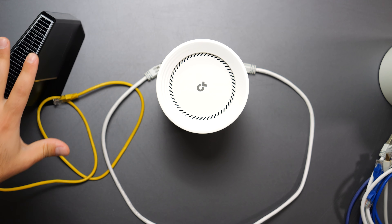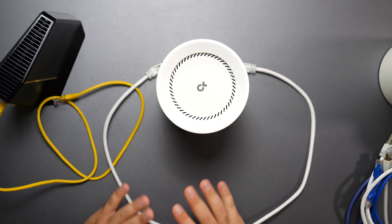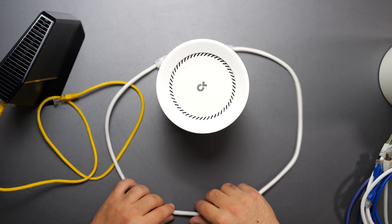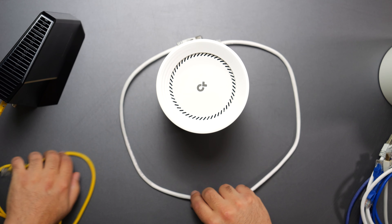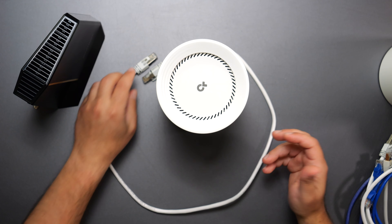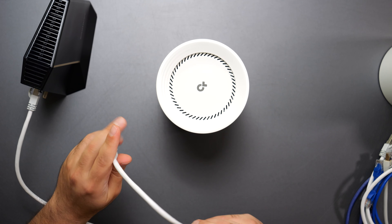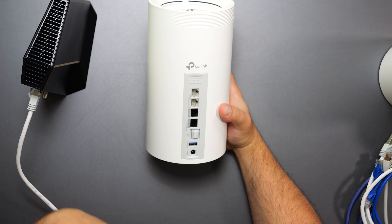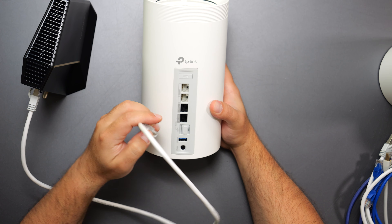This modem is capped up to 2.5 gigabits, but setting that aside—if you're going faster than gigabit, even though CAT5e is okay for short distances up to about 2 or 2.5 gigabits, I'd look at CAT6 or CAT7 cables. Starting with the CAT7 cable and assuming this modem goes to 5 gigabits per second, I'd plug it into the modem, then take the CAT7 cable and pick one of the two 10-gigabit ports. It doesn't matter which, because they're all auto-sensing.